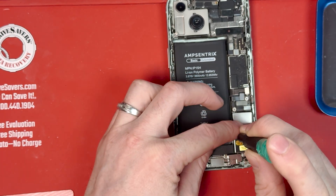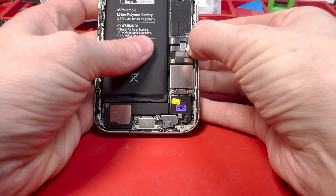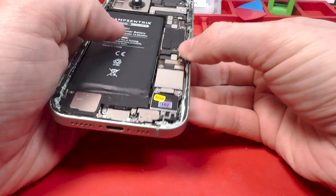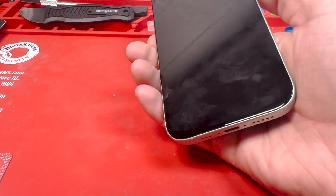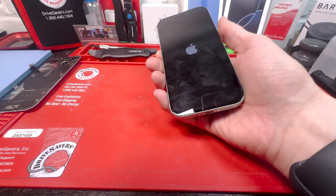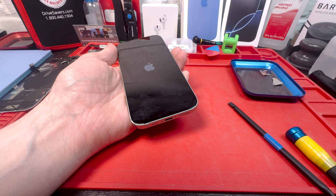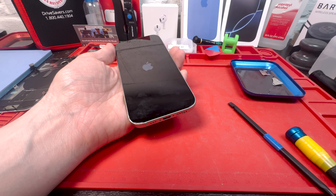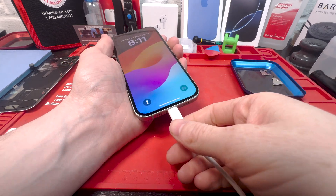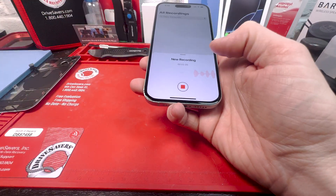We got it all put back together. Connect the battery — don't put the back on just yet; you'll get a message without the back but that's not a big deal. Turn it on and plug it in: check if it's charging, check the microphone, check the loudspeaker, check if it's vibrating, and check for cell service. If everything works, go ahead and put the back on — I have a separate video with a detailed guide on that. If the repair fails and you need data recovered, check out DriveSavers — I'll link a reference code in the description for a free shipping label and free estimate.